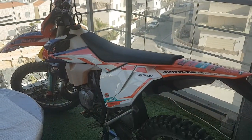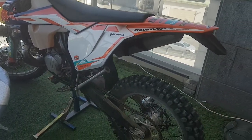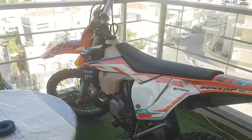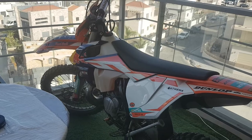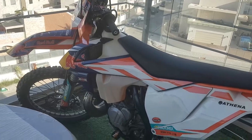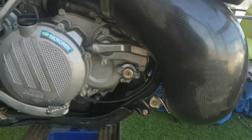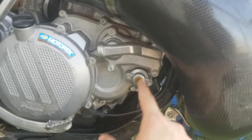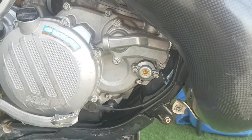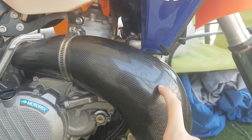It's pretty powerful even though right now the green valve spring is installed. I think I'll stay with it for now because I'm coming from a 125, so I need to get used to this powerful beast. Then I'll change it to the yellow and play with the adjustment to change when the power valve will open.